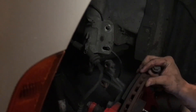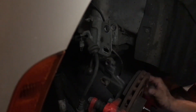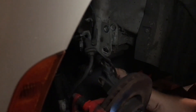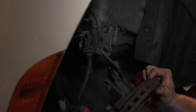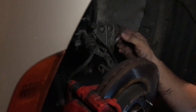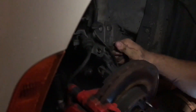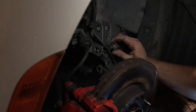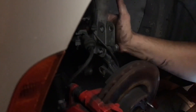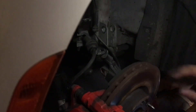So just to protect your brake lines, it's probably a pretty good idea to at least attach one of these bolts. It doesn't matter which one. I like to attach the one on the top of the spindle to the bottom of the coilover. And that should at least keep it in place for now. That way you don't stretch out these brake lines.